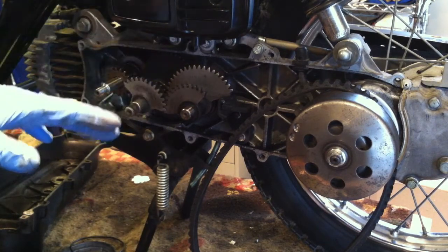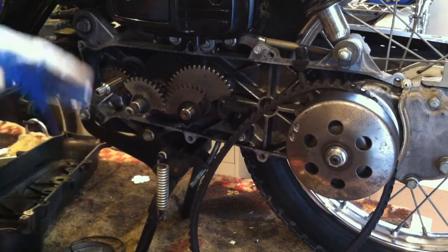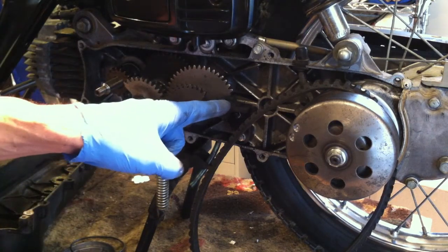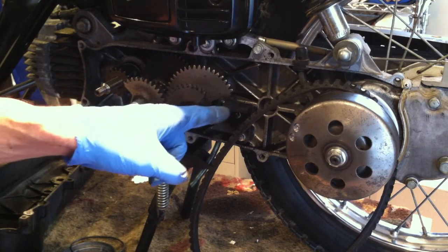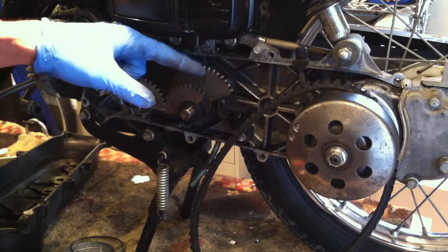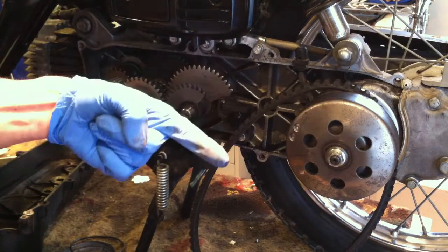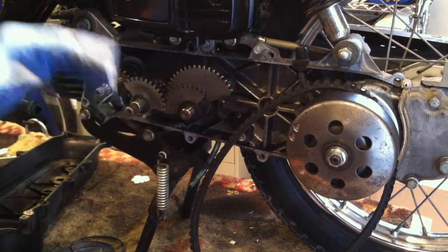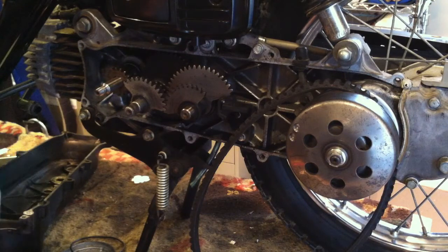If your gears don't stay in their spot, it could be because they're worn, or you're missing washers and bushings that are supposed to be there. It could also be this rubber stopper — it's kind of like a ramp that wears down over time. If it holds this gear in place and the rubber wears down, this gear sits too far back and won't mesh up with the other gear right. That's why often when you pull off the cover, the gears get loose or pop out.